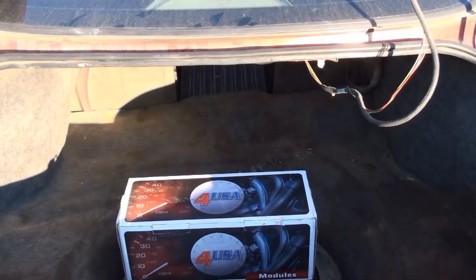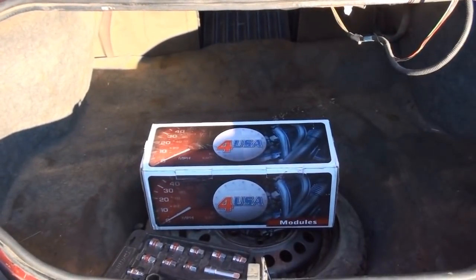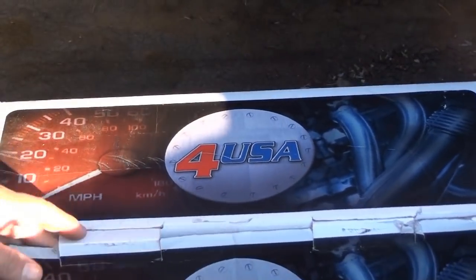It's always been a good engine, but when it comes to wide open throttle, this thing just kind of hesitates, and I pretty much replaced everything on the car. All I need now is just the fuel pump, and the fuel pump is real whiny sometimes, and sometimes it's quiet. So I've ordered one through the internet, and it's not any specific brand, but it's supposed to be the right one for this car, I'm hoping.